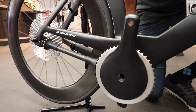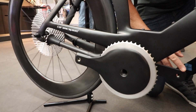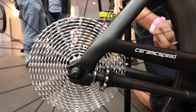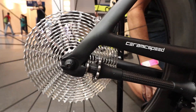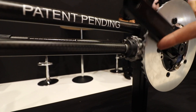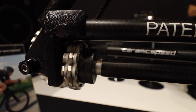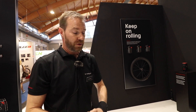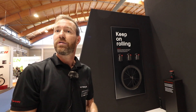What we've done here is we've removed the chain, we've removed the rear derailleur, and we've replaced it with a drive shaft that has teeth and bearing interaction. The chain has eight points of sliding friction. Those eight points of sliding friction with the rear derailleur pulleys are a lot of pieces and parts moving around and it creates a fair amount of friction. So what we've done is we've replaced those eight points with two points of contact — the teeth interacting with roller ball bearings. This has pretty much eliminated the sliding friction in the driveshaft system, and all power is transferred from the teeth into ceramic ball bearings in a radial manner. So the only friction we have is from the rolling elements of the bearings interacting with the teeth, and no chain sliding friction at all.